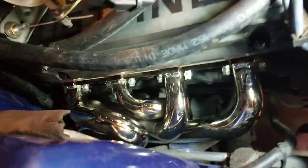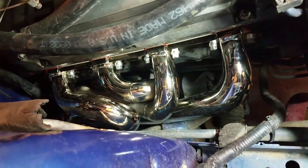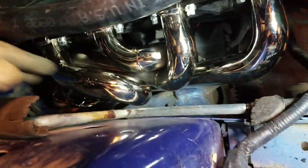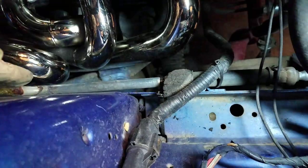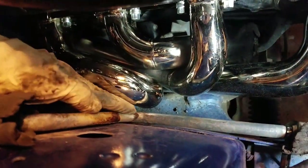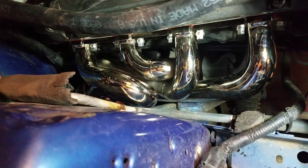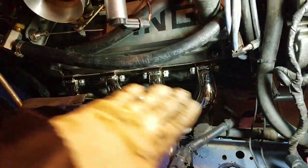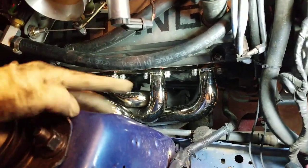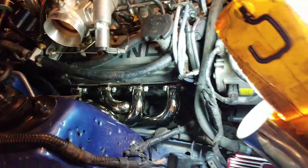We have this passenger side header all set up. Once we got the engine lifted, it slid right in place and everything bolted on really nice. The only thing I did on this AC line is put a zip tie right over here to make sure it stays close to the frame — there's very little room, so you don't want it hitting on the header. My colleague is down there tightening up the H-pipe to the header — everything lined up good. I'm going to put the new plugs on this side, the wires, and then put the intake back on, and we'll fire it up to make sure everything looks good.